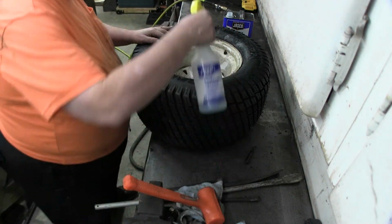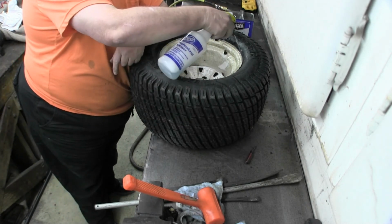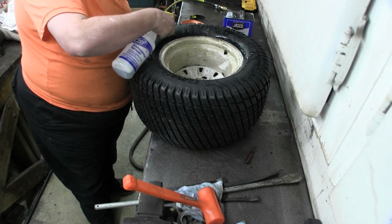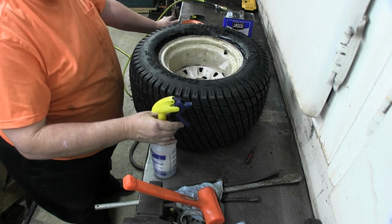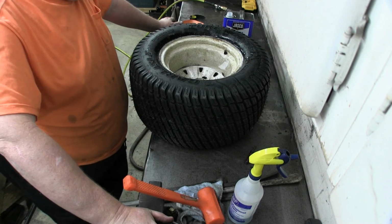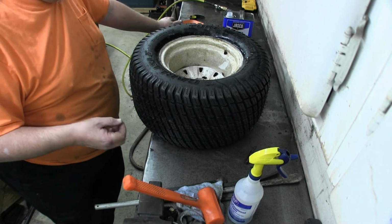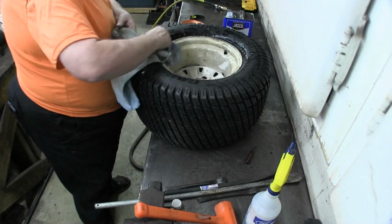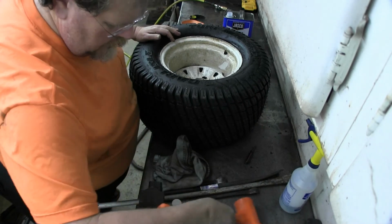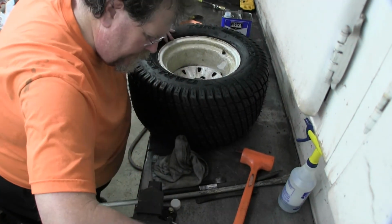All right, so now, bubbles in the valve. Yeah, no bubbles. Real slow set. They sell really fancy bubble detectors. What I use is really dumb. Soft soap, cut about 1-to-1, maybe 2-to-1 with water. Then you spray it really slowly, and you get a thicker bubble detector. It actually works pretty good. No bubbles. Best we can tell. We will put the cover back on there, which I've put someplace. There it is, hiding underneath.